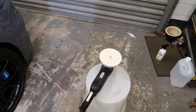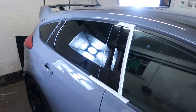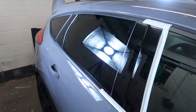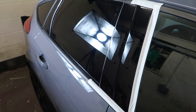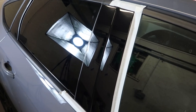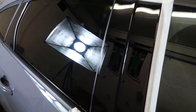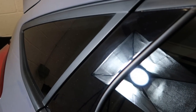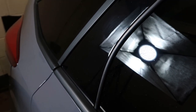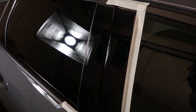So that's the end of the video. I hope you liked it. I apologise if the camerawork was a bit shoddy. But all you need is a machine polisher with a soft pad, some masking tape, and some kind of ultra-fine polish. It doesn't necessarily need to be Rupes, although it is an incredibly good polish — any ultra-fine polish will do the job. Try to get one that's not got fillers in it so you get a true reflection of what the corrected panel looks like after. But look at how glossy and black that looks compared to that untreated panel. I should probably go fix this one now. I hope it was helpful to you if you're trying to fix micro scratches on black plastic trim.